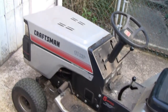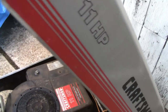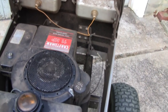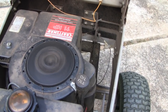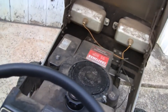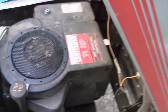I'll check the date when I take the hood off. I'd say I've had this tractor close to 35 years because I bought it new. I'll show you what it sounds like. It's still popping, doesn't want to start. Before when I was trying to start it while it was still hot it just kept pop pop pop popping. I'm guessing I might have sheared a flywheel key.